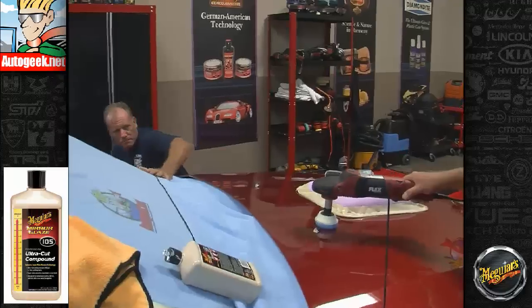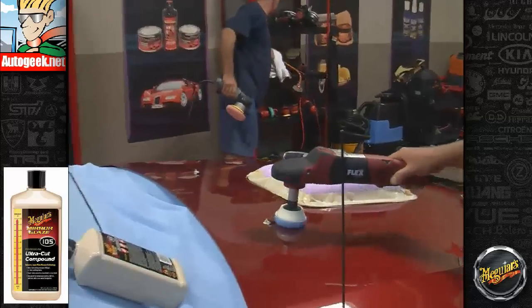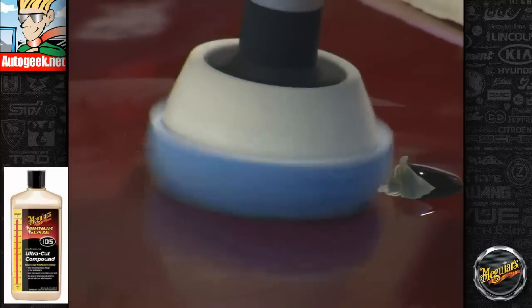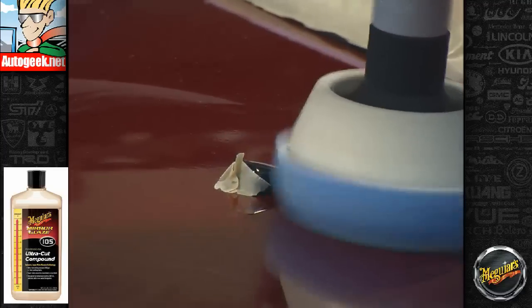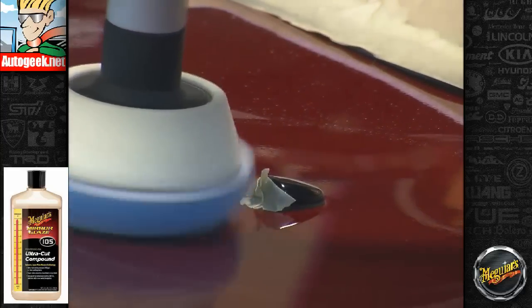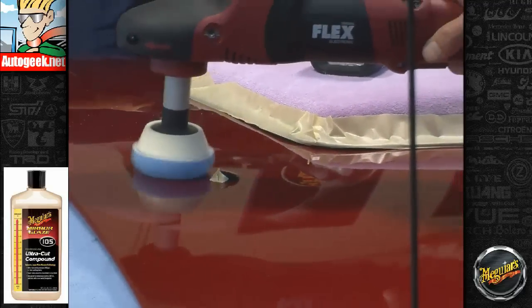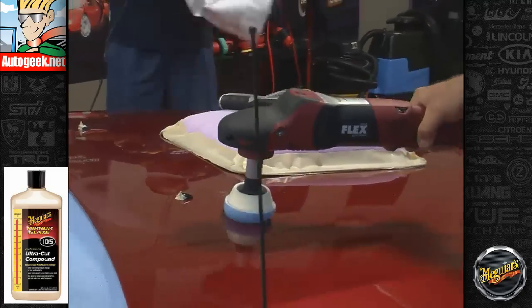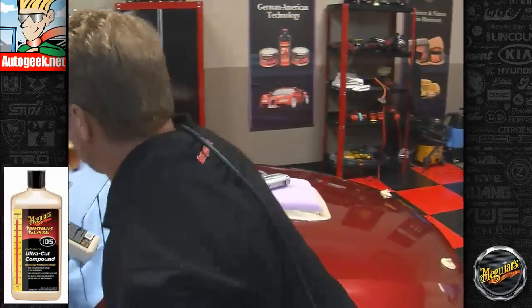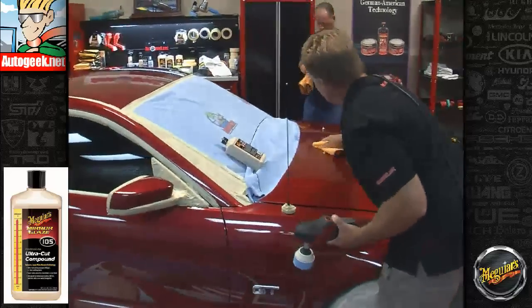This is what's nice about the surgical buffing technique. Getting a small pad on an adapter, I'm just going to get in here real close to this water squirter. And it's so easy to do. I'm actually just using one hand, and this is probably a little bit more than the weight of the polisher there. Go in there and get rid of all the swirls around that. Now we'll come back and tackle the major panel with the larger polishing head. But just to get in there and get rid of those swirls right there, I'm going to use a little 3-inch pad.